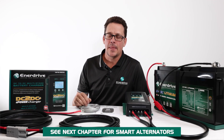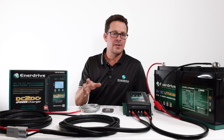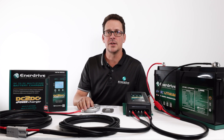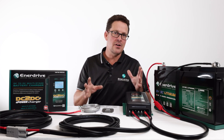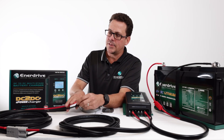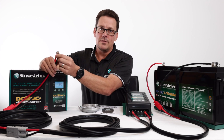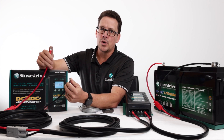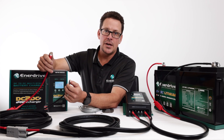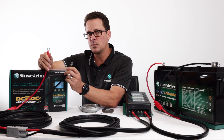Let's take a look at the installation. The mock-up here on the table is more of a typical caravan or camper trailer application, but it'll be very similar across various different installations. The primary layout is very similar across the range of applications. We start at the main starter battery under your bonnet. Whatever size lugs you have, you're looking for the best possible connection to those battery terminals — whether you add a bus bar or go directly onto the battery clamp. Some cars have an inbuilt fuse box, but direct connections are preferred — we don't want any voltage drop.